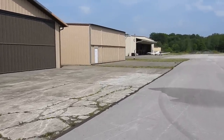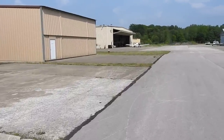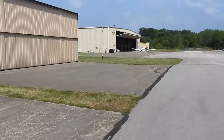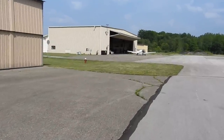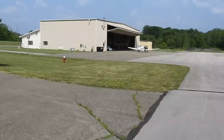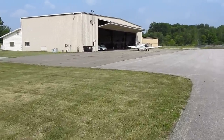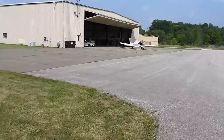Kind of winded, up and down, up and down, up and down underneath that airplane for the last 4 hours. That took way longer than I expected, but then there was some re-rigging I had to do, and it took a while to get the flaps hooked up and get the compression bushings in the wing spars. But everything underneath is torqued down, buttoned up, safetied, everything that needs to be safetied. So all that's left is them little covers, them damn covers. You know, they've been like that all the time I'm building this thing this year, last year.